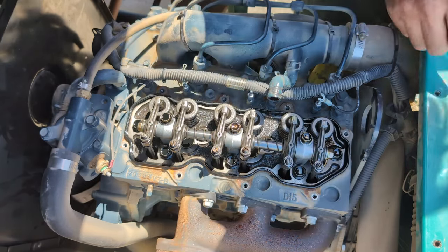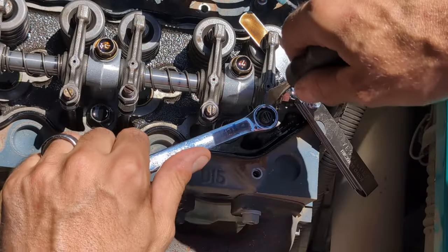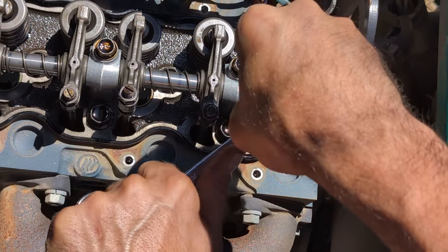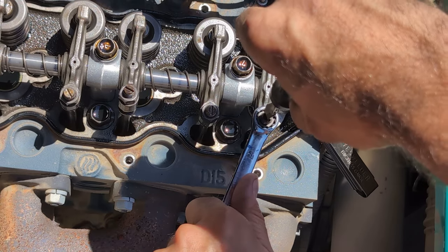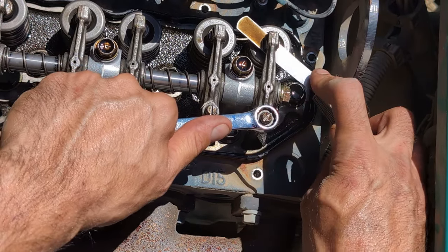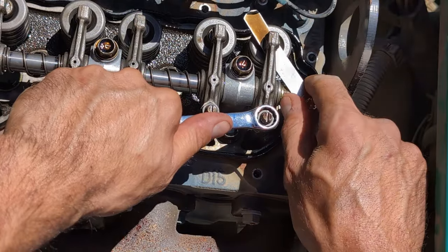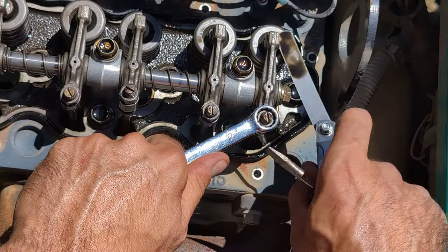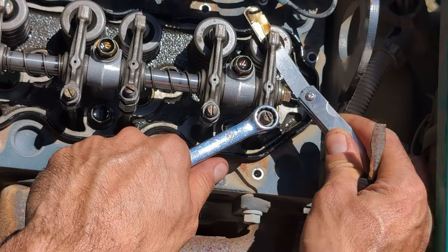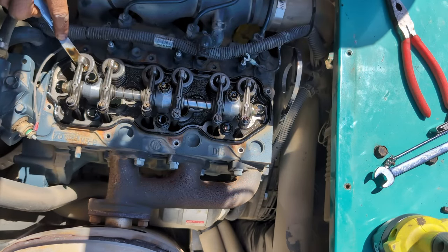We want slight drag on this. We're going to loosen up our tappet connections here and tighten that just the tiniest bit. How this works: we're going to hold this flathead piece with a screwdriver and then gently loosen. Then we can turn this flathead piece just a tiny bit — usually about a quarter turn is all we want to start — and then kind of lock it back. Way too tight — see that? It's a really small adjustment. Still too snug. You can see the tiniest adjustment makes a difference. Yep, that's it. That's about what the other one feels like.